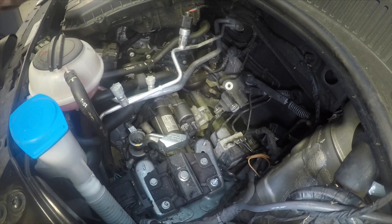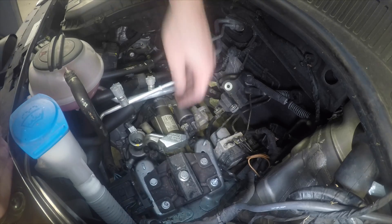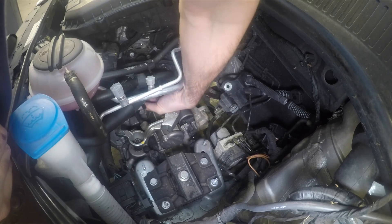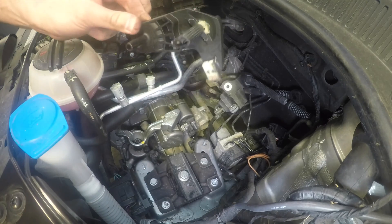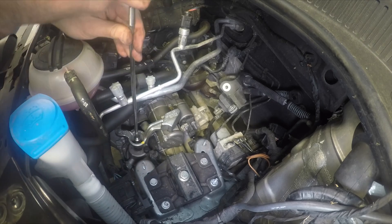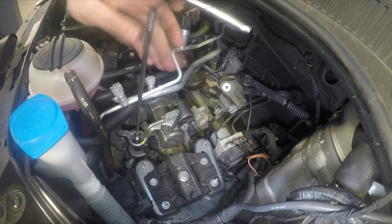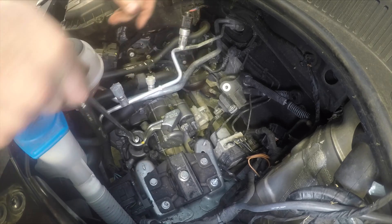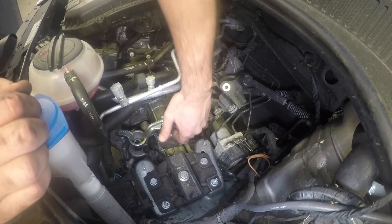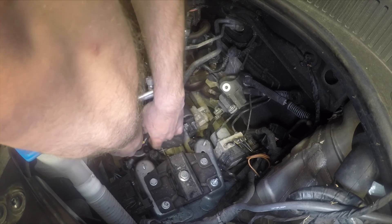Now we've taken off a little white plastic clip that holds the next part of the gear selector mechanism. There's a plastic plate that the gear cable is connected to which we're removing. Then we're going to undo the 13mm nut that holds the balance weight on top of the gear selector, and with a little effort that will just slide off and out of the way.